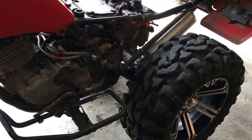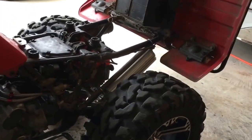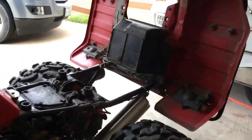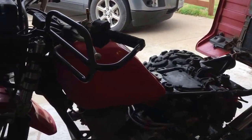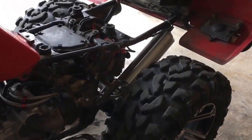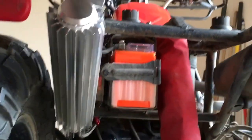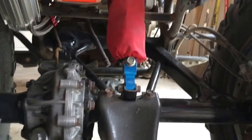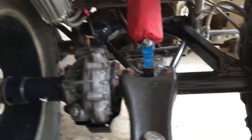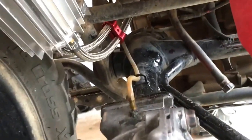I do everything with this bike. Normally it gets to be 100 degrees here all summer long for days on end. When I first cranked this thing up and ran it, it was about 55 degrees outside. I ran it for 30 minutes — once I was certain we were oiling okay — I ran it hard, and that cooler was just barely warm to the touch. I can already see the benefits of having it. I'm glad I did it, and I have no regrets. It adds almost a quart of oil to the system, which is nice — everybody would like to have more oil for protection and peace of mind.